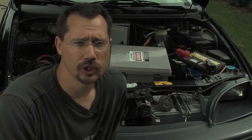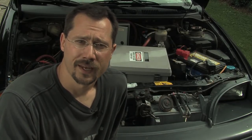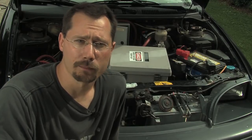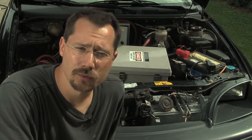The one thing I really couldn't get around is most modern cars have power brakes. And what power brakes really are is vacuum brakes. The vacuum comes from the engine, and that vacuum helps suck on the master cylinder, giving you that boost to your braking. Since we took out the engine, there are no power brakes, so I had to figure out a way to make extra suction — and I did that with a vacuum pump.